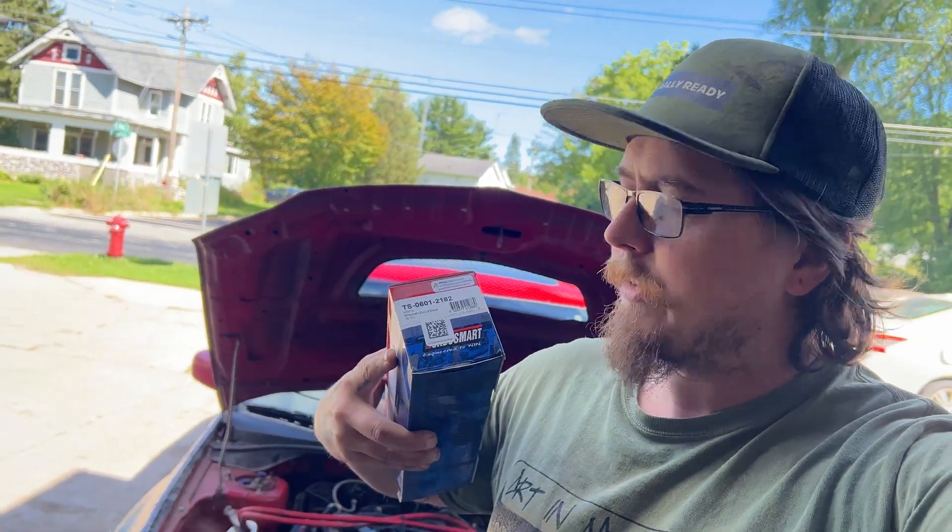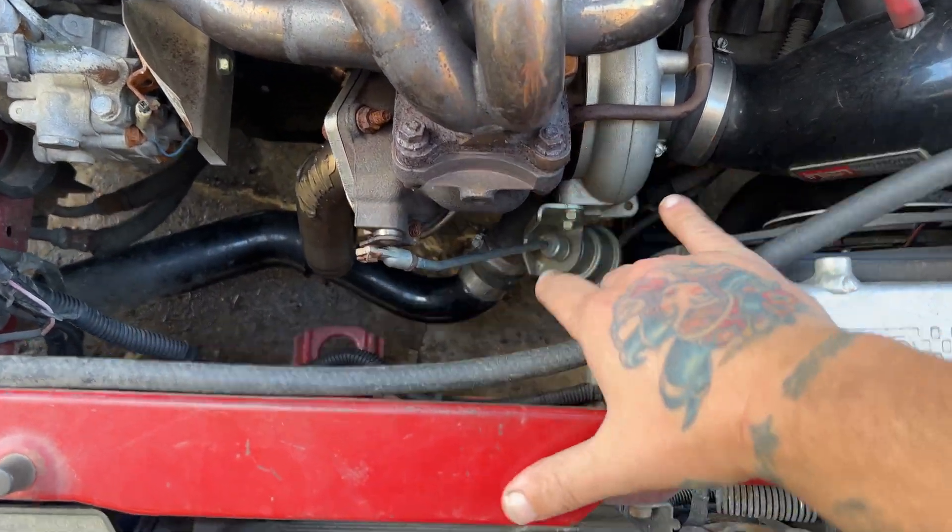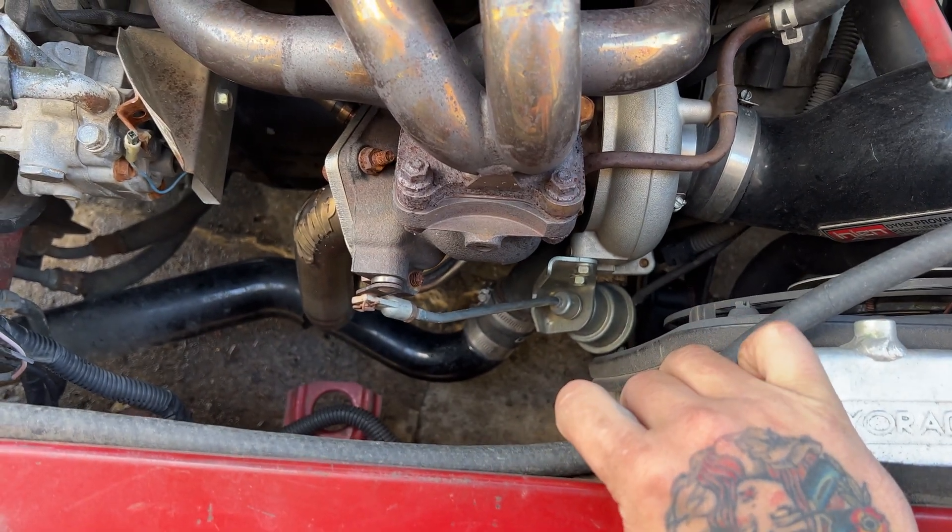I haven't really updated you guys in a bit on the E85 tuning. It's been going okay, but we ran into a big problem right away — as soon as I went to turn up the boost past what I was running, it didn't want to hold too well. I think I'm overrunning the wastegate actuator. I've got a Turbosmart 18 psi wastegate — about 4 psi higher than stock — so I'm going to throw that on. Unfortunately I'll have to zero out all of the old boost tuning maps and start over, but at least all the fuel is done.